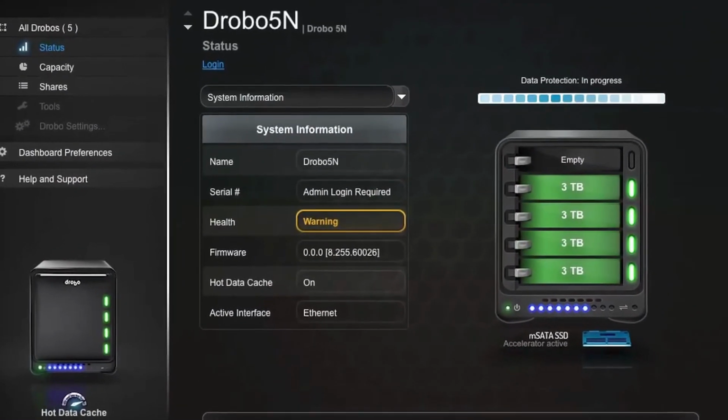And then I pulled the second drive out that was close to failing and replaced it with another larger drive because you get more storage in there as long as I'm at it. And it started rebuilding itself again. Now, each of these rebuilds takes about a day to complete or so, and you can't shut anything down. But about midway through rebuilding this array and getting the redundancy back, the entire housing failed.